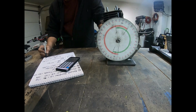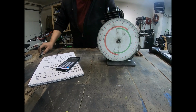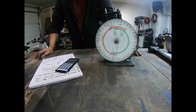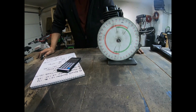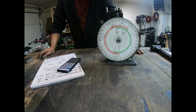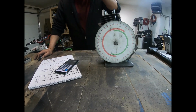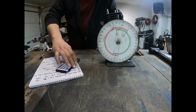which is pretty good. I mean, the engine's going to probably be hitting about 7,000 RPM before it really starts to hit. That's the way these Minarelli cylinders kind of seem to work. Yeah, 19% is not a bad number. This thing should really wind up, like I said, about 7,000 RPM.